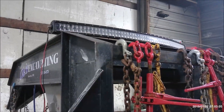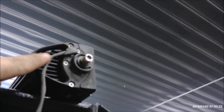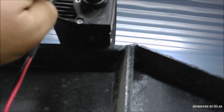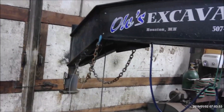This is a light bar I had on a plow rig that I put on its lid a couple years ago. The wires had pulled out of it and I just had it sitting in storage. I took the end plate off and there was enough wire in there to add wire back to with a couple of good quality butt connectors. I fed a red and black wire out through some shrink wrap and put a new cover on it. We'll make some mounts that bolt on and catch that guy there, then wire this into the red wire from the trailer wiring — which has constant power — and put a switch on it so we can have it when we want it.